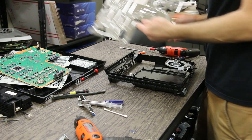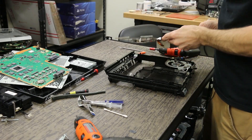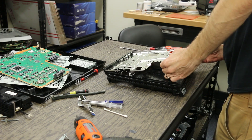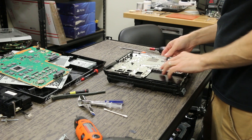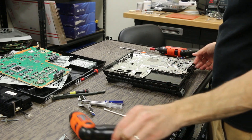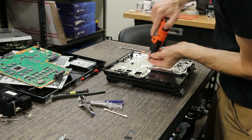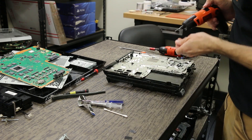If you want to replace the fan, that's done. The next thing is to grab the metal piece with the heat sink on the back. We put the back of it in just a little bit first, then match it up and let it sit down. Then we've got our three Phillips number one screws — you could use a smaller screwdriver if you wanted to.